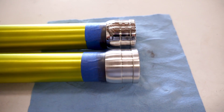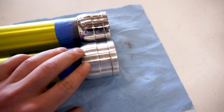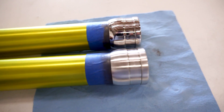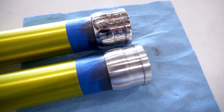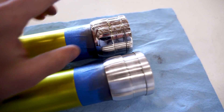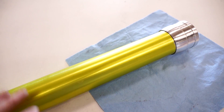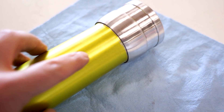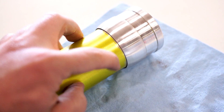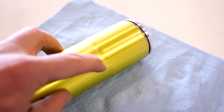Got these caps all smoothed out looking pretty wicked. What I ended up doing was polishing out the entire cap and then grabbing some Scotch-Brite and rebrushing it - gives it a lot more depth. It's almost tempting to keep these things polished. But if you guys decide to strip the anodizing off your fork tubes like I did, just make a hundred percent sure you get all of it off right up to the edge. I definitely learned my lesson on this one.